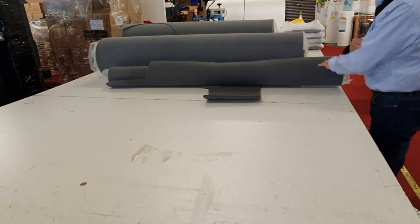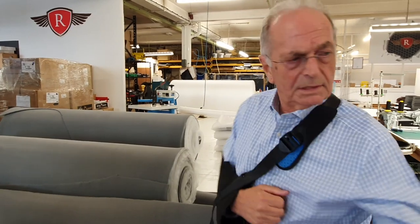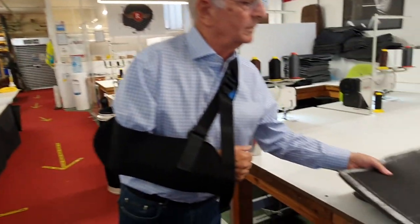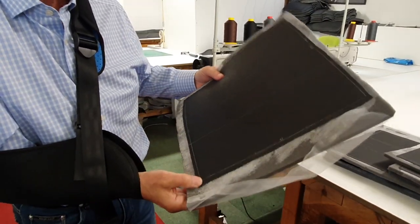And then you clean it first, don't you, Steve? Well, it's first cut and then it's padded or laminated — whatever thickness it is depending on which part of the vehicle we're trimming — and then it gets cut to perfection. So it's had its first cut, I've got the padding on, and now we'll cut that round the score lines.